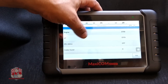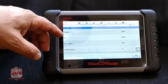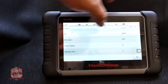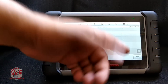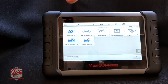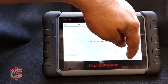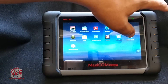I've also got live data, component test, vehicle information, and a status screen. Hitting status lets me know about the particular car — the different modules I have access to on the OBD2 side, which includes the engine and transmission. It shows zero codes found, the MIL malfunction indicator light status is off, two monitors don't apply, eight are ready, and zero are incomplete. This is really useful for buying a car, whether from a dealer or privately, certified or not.